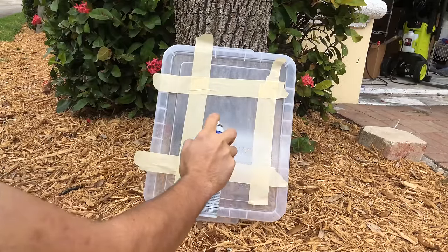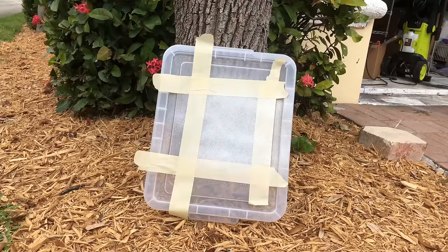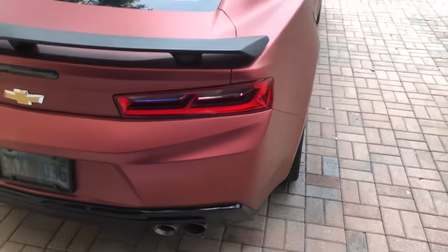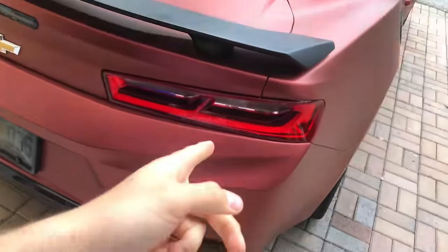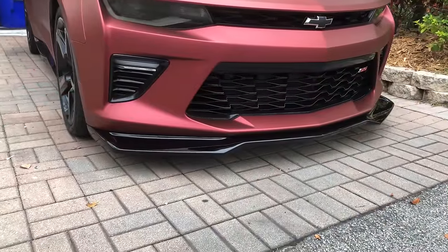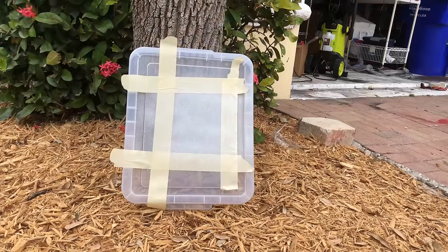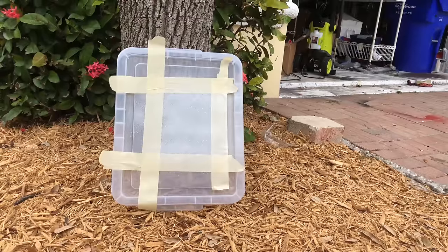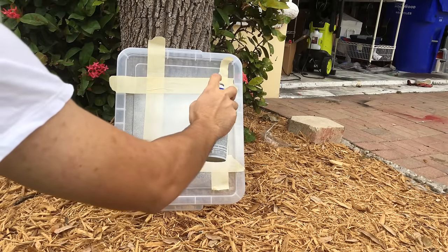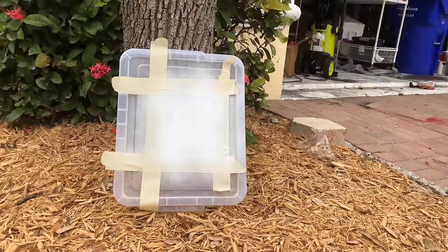Start with a light tack coat — this creates the foundation for all the dip to stick to your car. You need to let this first coat dry for about five minutes. While the plastic dip is drying, I'll show you around my car. Since last week's video I've removed the tint over my tail lights, and I've installed a ZL1-style C7 front splitter and also the ZL1-style side skirts. It's been five minutes since I laid down my first tack coat, so now I'll go back over a little bit heavier. You want the second coat to dry for about 10 to 15 minutes.